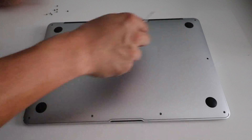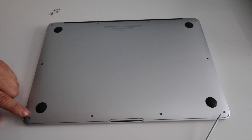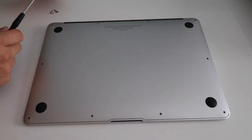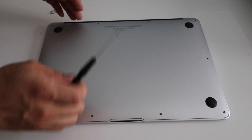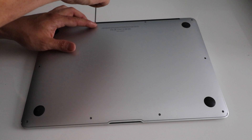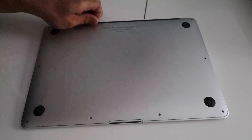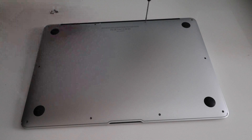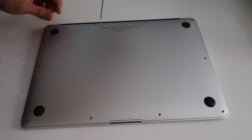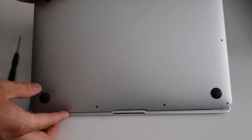First we're going to remove all the outside casing screws. The ones on the side and the bottom and this side here are all the same size. The two here will be longer. This is a special pentalobe screw made by Apple. And there goes the bottom casing.